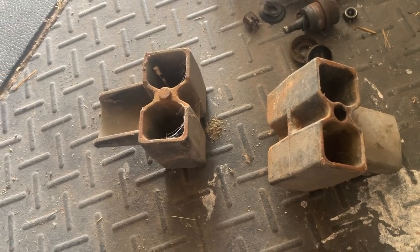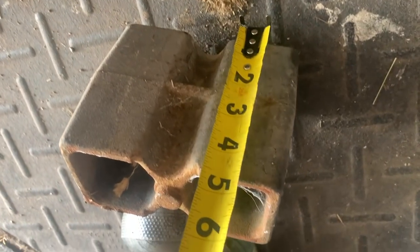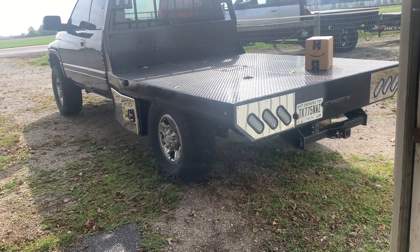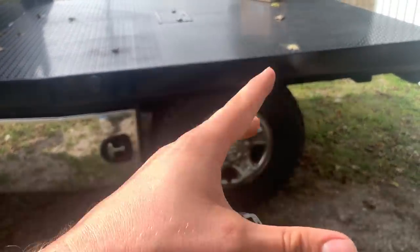In this application, this is all we're gonna do, is get this back up to factory in the back. And these blocks, I measured them out already, they're 5 inches. I thought they were 4. And the ones that are on it right now, I measured them, they're 1 inch. It's just a 1-inch block separating the axle and the leaf packs. But what that'll do, we should be able to see the entire rear tire plus about an inch and a half of extra, which will also increase the space between the tire and the flatbed deck by several more inches,